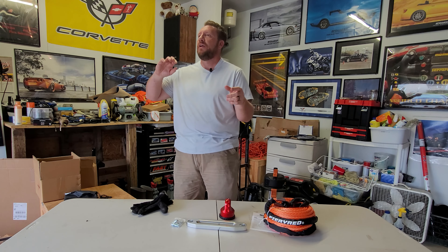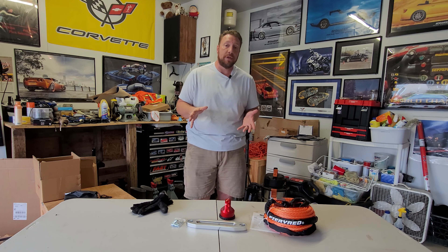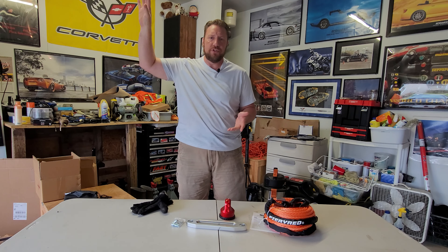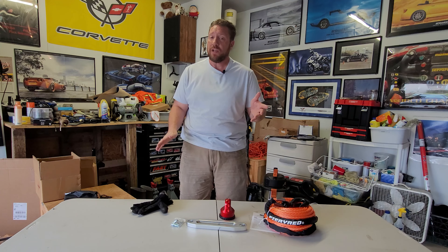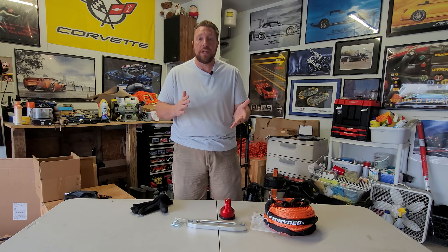As a little bit of preface, I have been a truck driver — more of a warehouse manager at this point, but I've been a truck driver for the last number of years. I spent a lot of years doing flatbed driving where you're always using chains and straps to strap things down, so you have to know the working load limit of all your equipment. A four-inch strap with a working load limit of 5,500 pounds will have a breaking strength of over 20,000 pounds, but that's not how you use the equipment. You are legally obligated to use equipment based upon its working load limit.